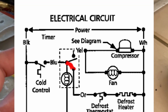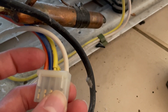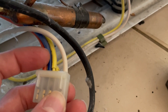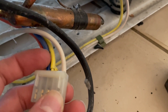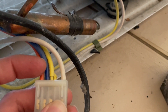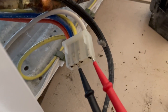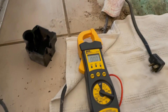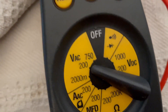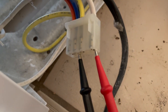Looking at the diagram, the timer connects the blue to the orange whenever it's in defrost mode, which means the compressor would be off. So it's either blue-yellow connected or blue-orange. I'm going to plug it in and check for voltage between the blue and the white. I've got my multimeter leads in, set to AC voltage 200 since I'm working with 120 volts. Sure enough, the thermostat appears to be working because we do get voltage there.